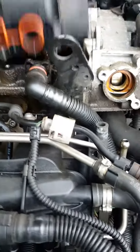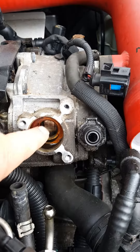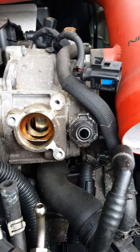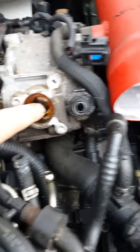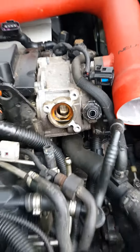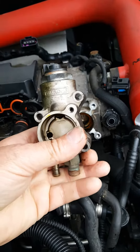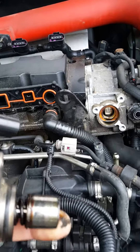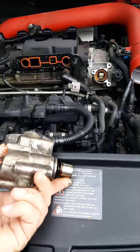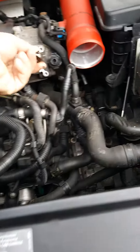The problem is it's not. Towards the end of the camshaft is this housing. Inside this housing is a lobe on the camshaft. This is the intake cam right here. At the end of the intake cam is a lobe that the high-pressure pump rides on. This comes off — unbolts from there, it's just three bolts — and this is a cam follower, which is what normally rides on that lobe.